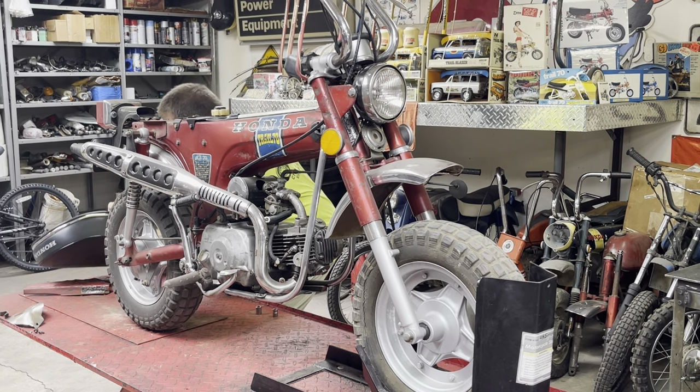Actually, I still have the brown wires that go back to the tail light. I still have to feed that too. All right, I got to make a jumper to get one more black power wire from the harness to the power of the taillight and the power of the illumination for the speedometer. So let me take care of that real quick.